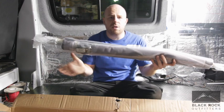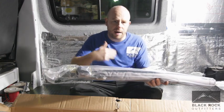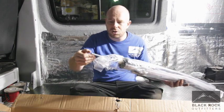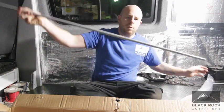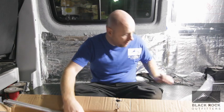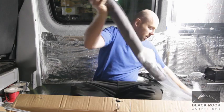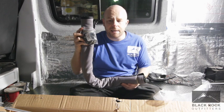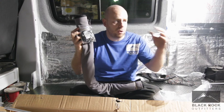You've also got two sets of these. Now what Vanex do is they wrap the curtains round the curtain rails, so when you take these out be a bit careful because there is a very slight burr on the edge and it can catch the curtains, but if you're careful they'll come out. Nice quality, very straightforward. Inside the bag you've also got your main curtain, and inside there on the end of the curtain you've got your fitting kit - end caps, tie backs, and screws to secure the rail to the van.